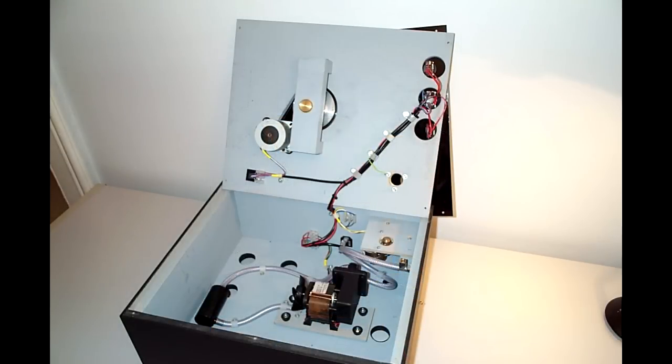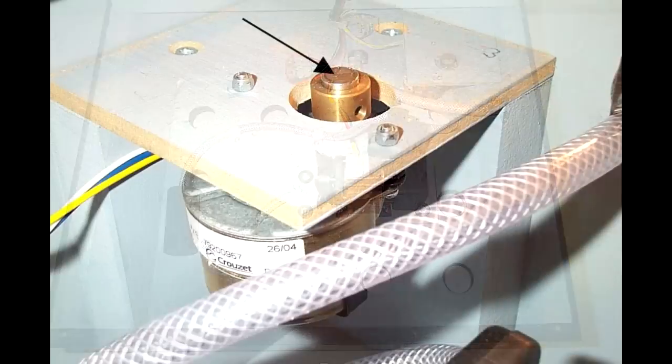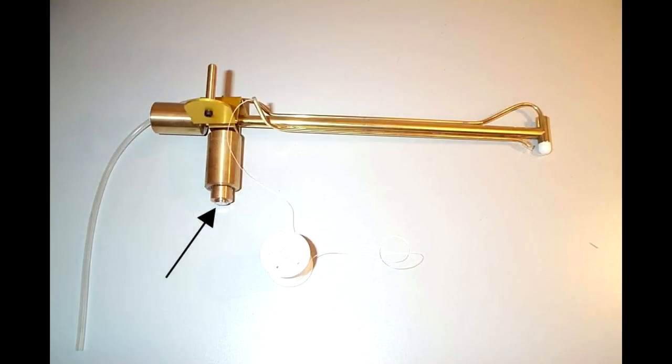Removing the upper case of the LoraCraft device once again reveals the attention to detail that the manufacturer puts into their products. The entire interior casing is coated with some sort of protective paint to guard against moisture and mildew. In the center of the box you'll see the vacuum pump we spoke of earlier. One thing to direct your attention to is the little gear drive motor that operates the arm. What makes this interesting isn't just that they chose to use an inexpensive gear drive motor, but what they did to protect the unit from damage: they put a little magnetic clutch on it. On the shaft of the motor you'll see a little flat piece of machine steel, and on the bottom of the vacuum wand there's a piece that looks just like that, but it's magnetized.